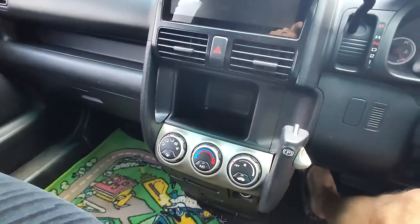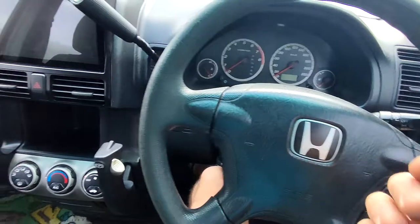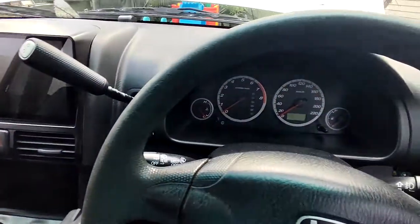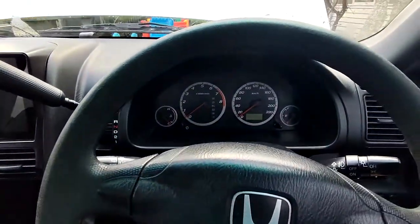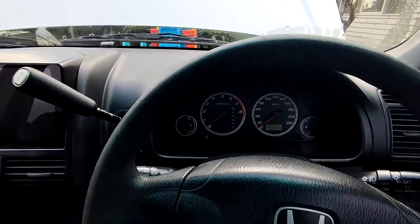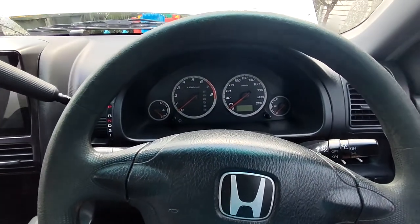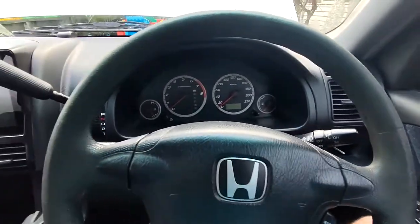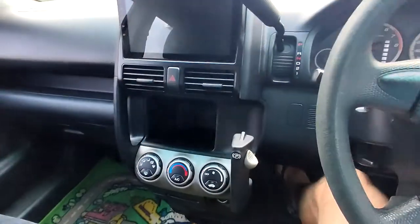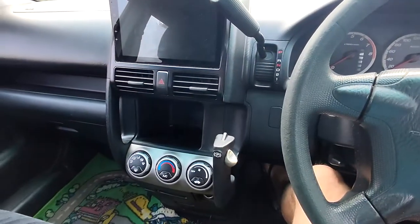So with all that testing, I'm happy to say I believe I'm just low on gas. The compressor is kicking on, the RPMs are dropping, it's not making any weird noises. I get no RPM drop when everything's fully connected, but the pressure switch once jumped is causing the RPM to drop and the condenser fan to turn on. So I believe I'm simply low on gas. I'm going to leave the paper clip connected, run the car for a little bit, let it idle with the AC on and just see if it gets cold. If it gets very lukewarm, I'll conclude I just need a regassing.